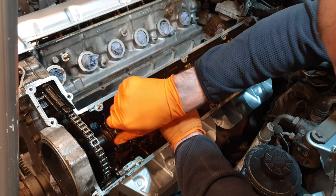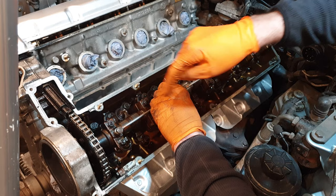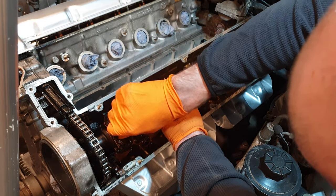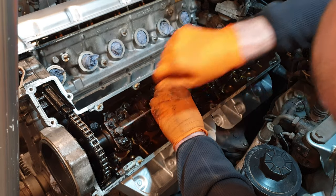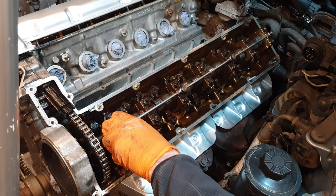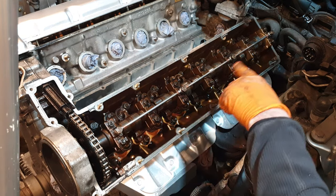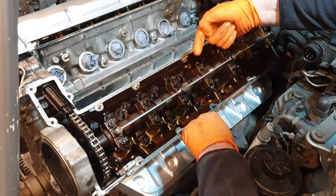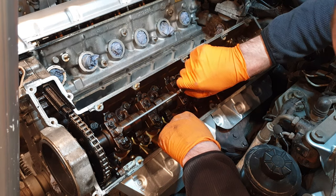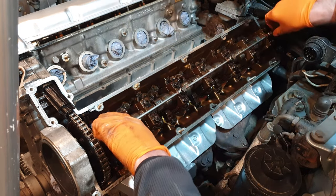One thing I didn't mention is I have all of these numbered, so they're scratched into the heads, 1, 2, 3, 4, 5, 6, 7, 8. So the same bolts are going back into the same holes. That's because, assuming the correct torque value was applied to them when I came across them, I marked them in the position that they're in. That way the holes that have been drilled in them should all correspond to each other, and the wiring should work out pretty well, fingers crossed.